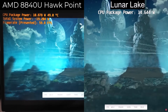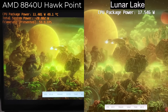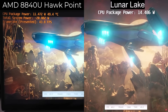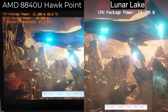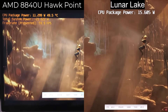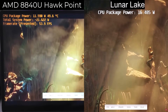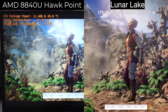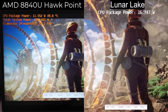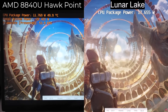If you're wondering what type of total system power Intel's Lunar Lake is using, it's basically going to be the display, the fan, Bluetooth and Wi-Fi — those are going to be what we consider extra from total system power. Realistically, you should anticipate anywhere from two to three watts extra. So if Lunar Lake is using 15 watts of package power, anticipate around 17 watts of total system power. If it says 18 watts of package power, anticipate somewhere close to 20 watts of total system power.